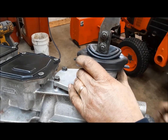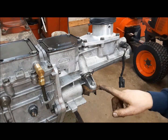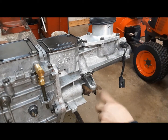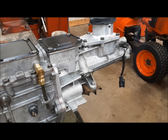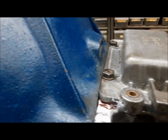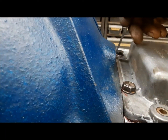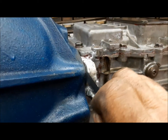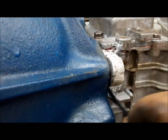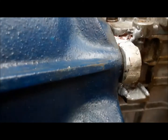Man, this thing will make any car fun. I found an old transmission mount that bolted to it — I don't know if it's the right one for whatever car I'm going to put this in, but it's a transmission mount. Now we're going to get this thing attached to a bell housing. Our first test fit revealed a small problem — because we machined the front face of the case, the shift cover actually touches the bell housing.